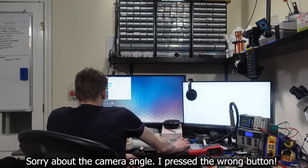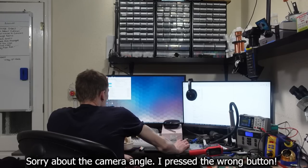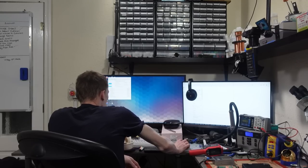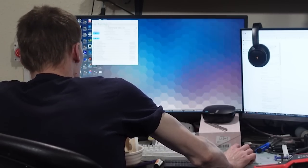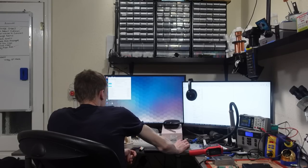That's actually reading as good. I'm just going to look at the statuses in terms of read and write. Look at that — 16 terabytes of write. That's a lot of terabytes. 14,718 hours — one year, 248 days, 6 hours. The good thing is it's reading okay, it's absolutely fine. So we've got a working SSD, which means we have a board issue by the look of it.